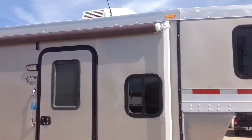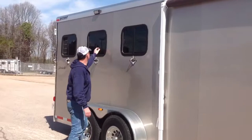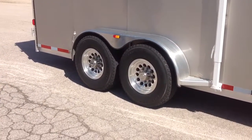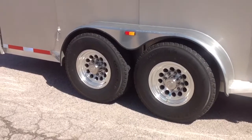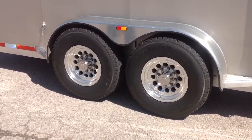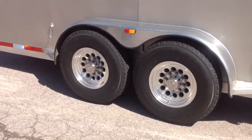We've got horse ties along the side of the trailer and slide windows at the horses' butts. This trailer has got two 6,000-pound axles on it, on eight-stud ST235 85R16 tires with aluminum rims and electric brakes on every wheel. We've also got a recharging breakaway system that charges off your hot wire out of your truck.